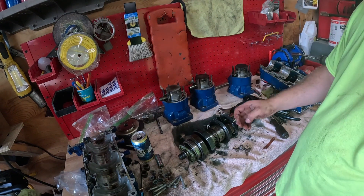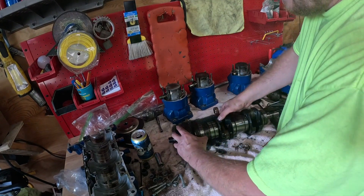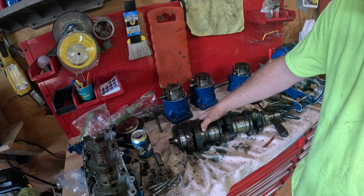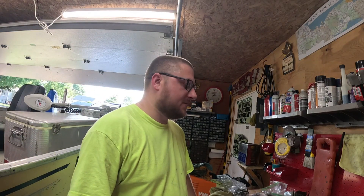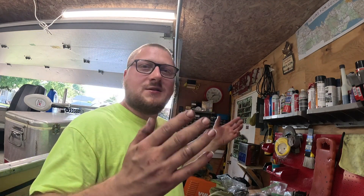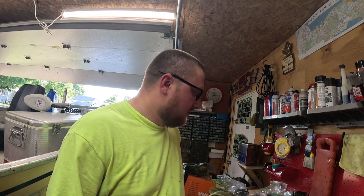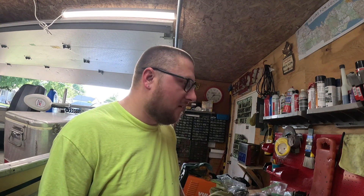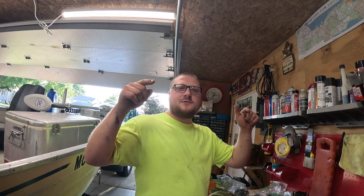Check my crank bearings while we're in here - just give them a wiggle. That's the end of that guys - I need a crank. Look at this - crank bearing is bad, that's where all your metal came from. You can hear it shaking. I'm gonna order a crank. Those cases I'm not even screwing with - I bought different cases. We're gonna get this piece of junk running. We'll show you guys how to hone the cylinders, rebuild the carbs. I was hoping to get it together this weekend but that is not gonna happen. We'll do a nice carb video, get them all built, get the rest of that hull cleaned up. Stay tuned, like, comment, subscribe.